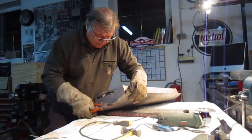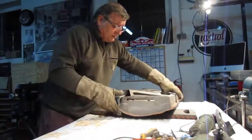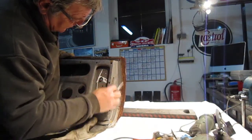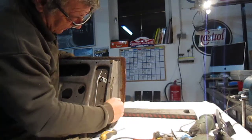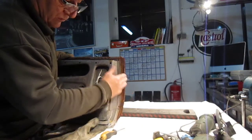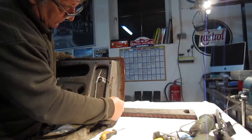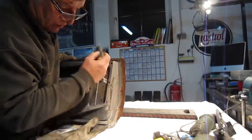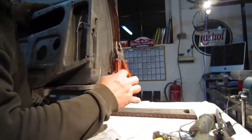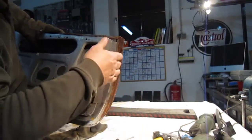I'll pick the camera up and show you exactly what I'm doing. You can see that this is the bit that's bent — it's almost through but not quite. There's the inside of it and I haven't touched the inside. Some people in videos say just keep going until you can see the layers — if you do that you're actually going to cut the edge, and when you fold it back it's going to be wrong. Any slight dip will transpose onto the door skin. Keep this edge as clean as you possibly can. On E-Types there are spot welds in four places. You can see it's almost through — all you need is a bit of heat, take some off, and away you go.